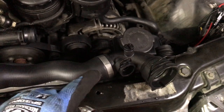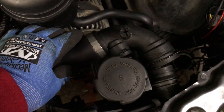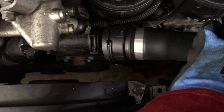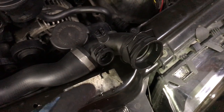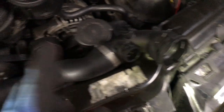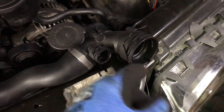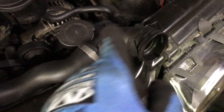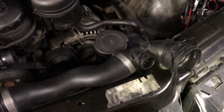Slide the expansion tank back in. You can put the upper hose back in — this goes right into the radiator and the expansion tank. Press it in. It helps a lot if you take a little bit of clean new oil, dab your finger, and run it around the O-rings on the inside of both ends of the hose and the end that goes to the expansion tank. Just run a slight film of oil in there and it'll go right in without much hassle.